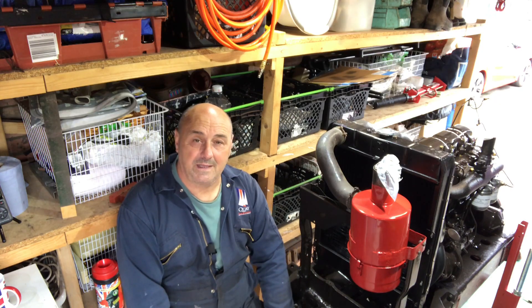Back to my garage this morning — we're going to fit the clutch today. We're not going to adjust it today; we're just going to fit the two plates, get them lined up, get it all buttoned up and tightened up. We will be adjusting the plates later on once I get the gearbox casing in place, the support snout, and the shafts back in, so that we can make sure everything's centralized and the way it should be in operational mode.